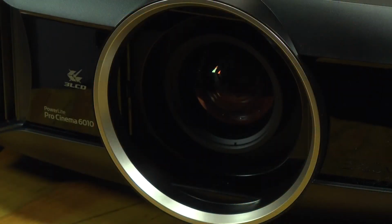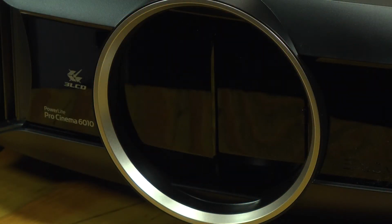It has this new L light bending feature where the light just goes and then hits the screen. I'm kidding. All right, I knew you'd be excited, but it doesn't do that, sorry. Other convenience features include 2 anamorphic lens modes, stretch and squeeze, so you can achieve true 2.35 to 1 anamorphic viewing with an anamorphic lens. Now, it used to be that you had to buy an external scaler and install that, but now it's all on board. About the only negative is the lack of a motorized lens, which is odd because there is a motorized lens cover. Now, with no motorized lens, you lose the ability to have lens memory settings, and that would be convenient for custom installers using the anamorphic options.